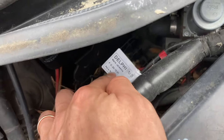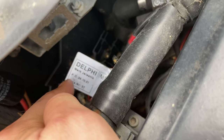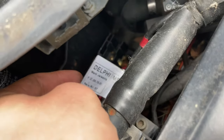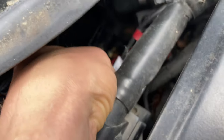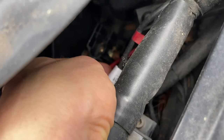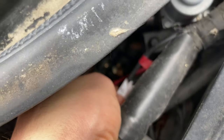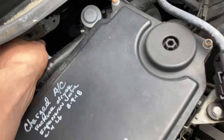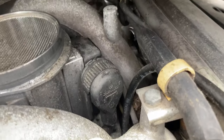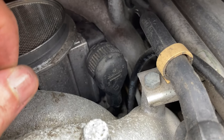Good news so far — it does have the updated harness. Looks like this one was manufactured in 2001. The FD stands for the manufactured date in German, so there's a design date and a manufactured date. The design date is 1992, and it looks like a W1212440-1906. I also checked the MAF, which has a little icon on it that also says 2001 — that's another way to check.